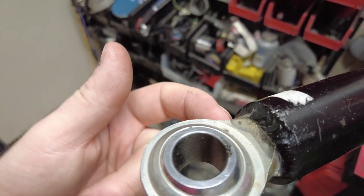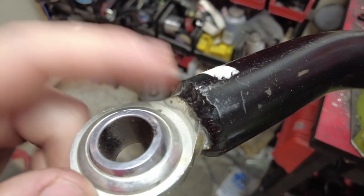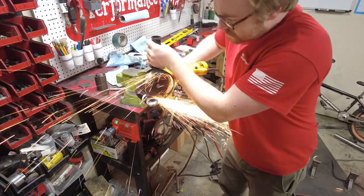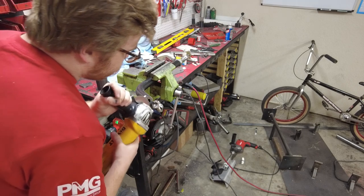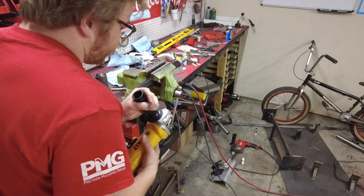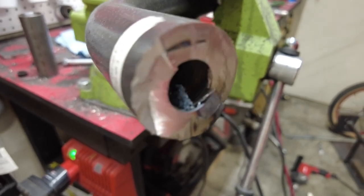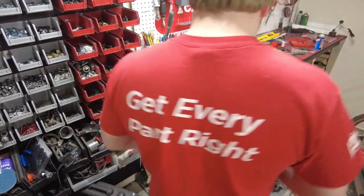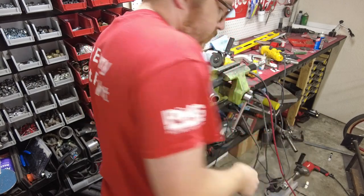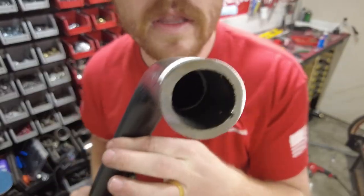First order of business — you can see it's just a female heim welded up in the tube; a lot of them do that. I don't know why, probably just because it's cheap. We're going to cut that off. You need further proof? There's just a female heim welded in there — you can see there's threads in there. We'll grind that off and pull the heim out. This is just a threaded heim, so I should be able to thread another heim in. Pull it right out — now we're just left with a tube.